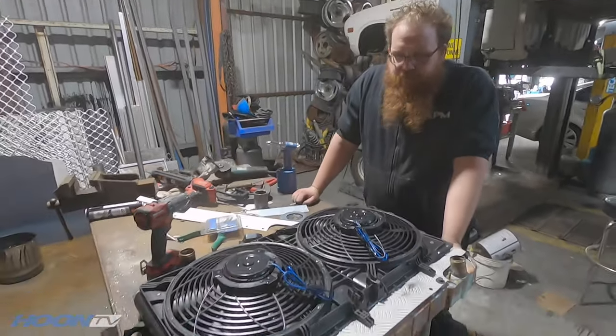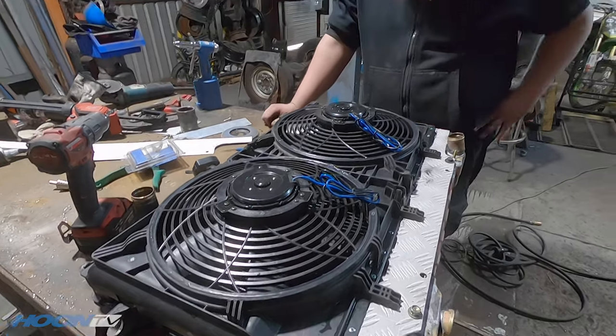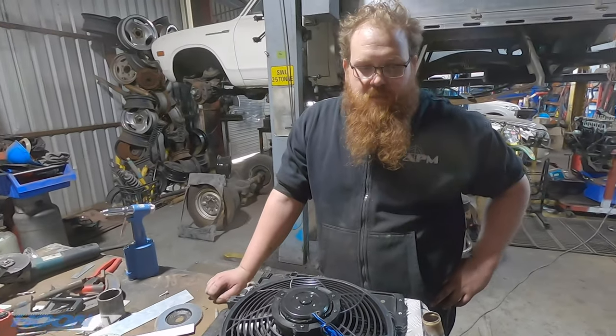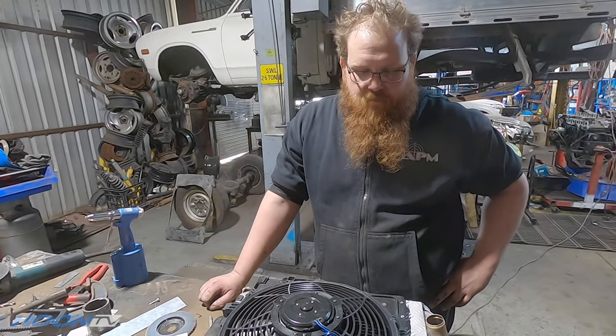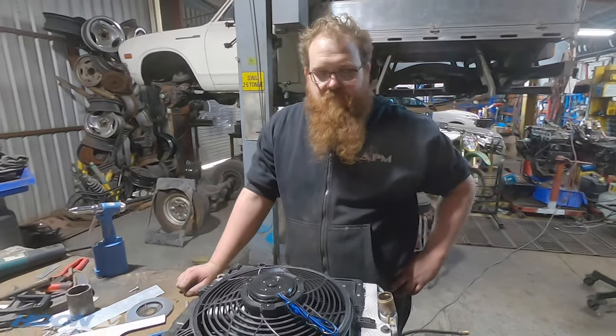So what have we done? Give us a rundown from when the radiator came in. The radiator's been cleaned out, the top tank moved, each tube rodded, it's fine 100%. Resoldered back together, doesn't leak. As for the Davies Craig fans, the foam on the inside of the fan shroud will give an excellent seal, pulling air right where we need it — they'll certainly keep it cool enough. Now just clean it up and paint it.